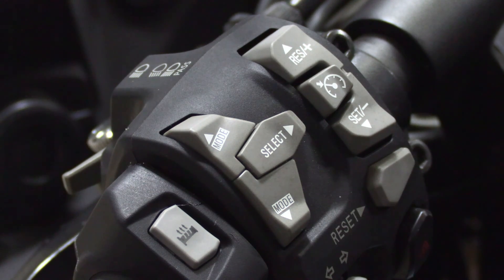What do I mean by that? It could show you code 11. Code 11 could actually mean a P0120, P0121, P0122, P0220, or P0223 error code, which means different things — throttle position sensor 1 malfunctioning with a wiring open or short to power supply, or it could mean a wiring short to ground. It covers multiple codes, but it gives you an idea of where to start.